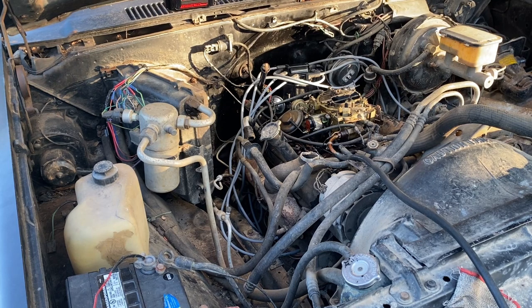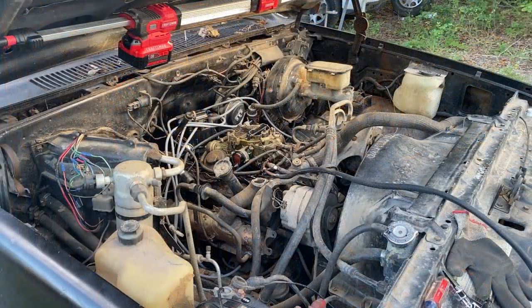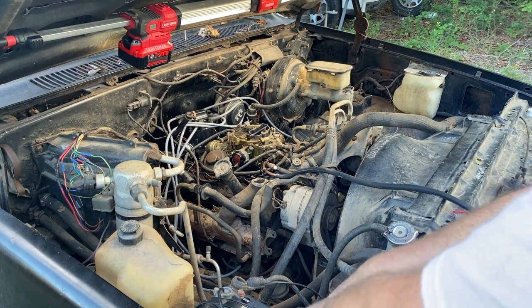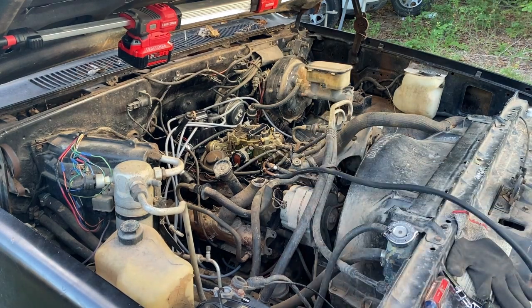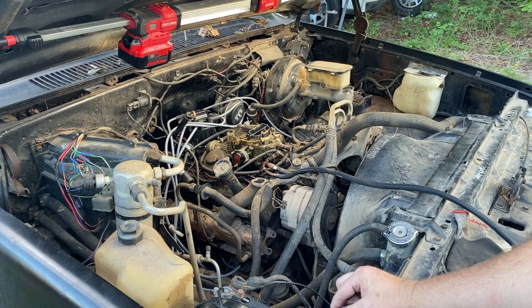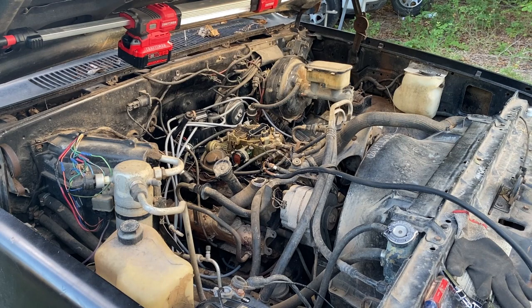So, all right, let me undo the fuel pump, and maybe it'll be dry, and we'll finally try to run this thing off our little clicky-clack pump down to our gas. All right, so I stuck a spark plug in there, but I've also taken out the actual supply. And it's quite a bit drier now. It's been about 5 minutes or so. I did kind of change my mind. This is supposed to be a low pressure clicky clacky, but I think what I'm going to do is just try to prime up the system. 1,000, 2,000, 3,000, 4,000, and just try to get a bunch of good fresh gas to the carb and see if this thing will light off and run. Man, that'd be sweet if it did.